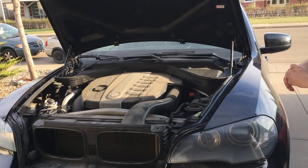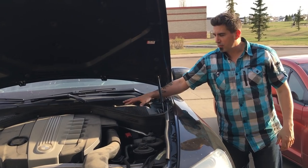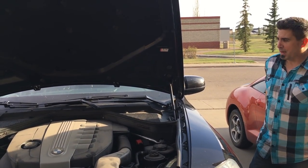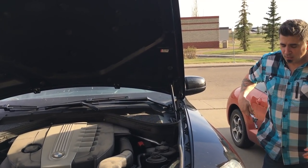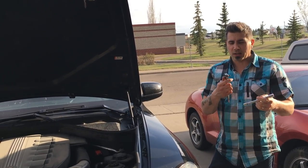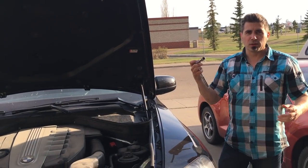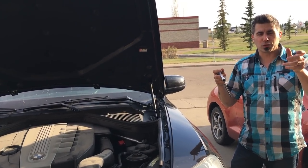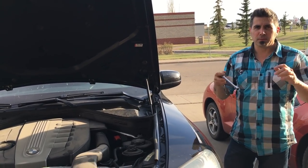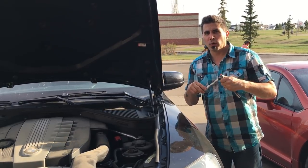The first thing you want to do is access your fluid reservoir, which happens to be up here, so I'm going to pop that. Now what you need — look at what I have in my back pocket — a 13 millimeter socket and a ratchet to drive that. Now you want to undo a series of bolts here. They're plastic quarter-turn bolts, typical for BMW for a lot of their hidden gems that you'll find. I'm going to show you where these bolts are.